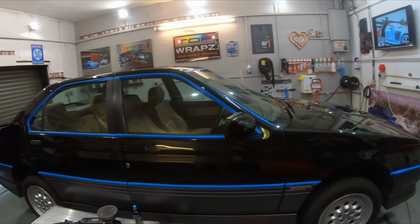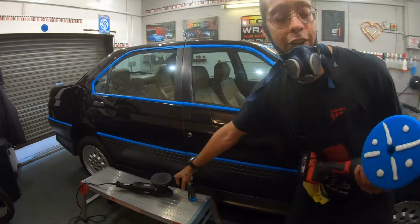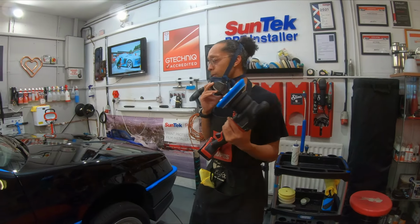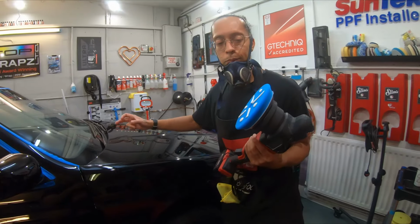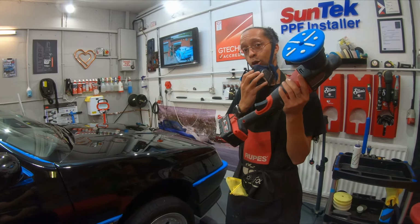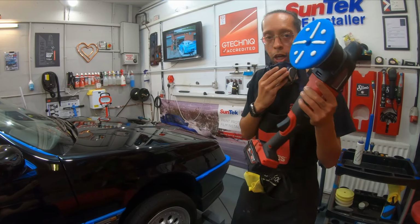First cut was on the microfiber, as you can see, a lot of paint transfer. We're now going over to an intermediate pad. So still going to do a lot of cut work, and we're just going to start glazing over these panels. We've got some degradation still left in the panels. This should do most of that clear up, and then we've still got a third pass to do. So we're going to blow through the car.